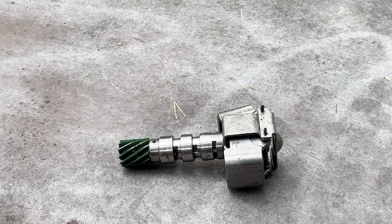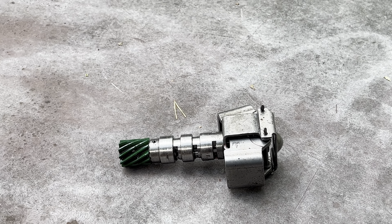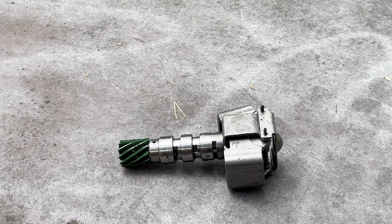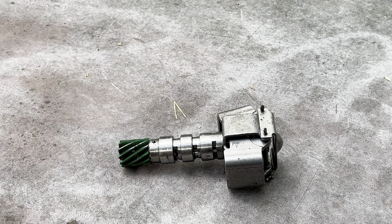This is just what you deal with when building these cars from scratch. The governor gear is really easy to uninstall. There's a little piece on the side of the transmission — on the driver's side of the vehicle. When the transmission is installed, on the driver's side there's a little circle piece that comes off. Just take a little chisel or a screwdriver, anything with an end on it, and tap around it easy — it'll come off. You're gonna lose some fluid when you do that, so just be mindful of that.